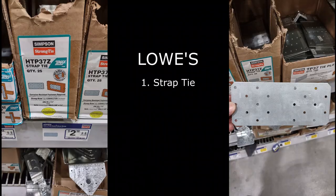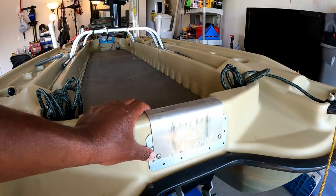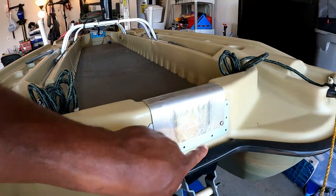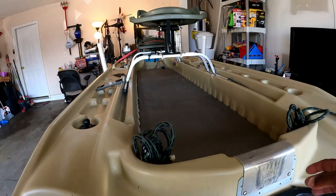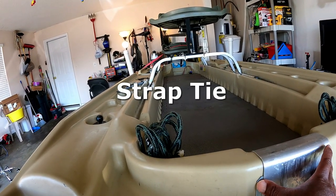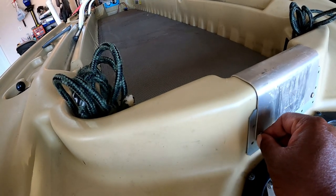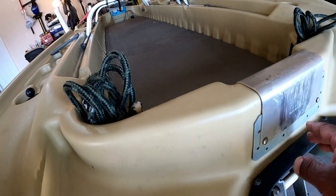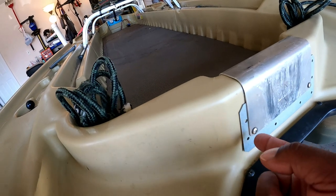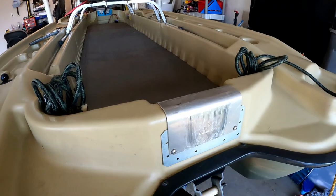So I had to do something about it. I went to my local Lowe's and purchased what they call a strap tie. A strap tie is a flat piece of metal used in construction of homes and small buildings to secure wood and prevent weak spots. I got lucky — the holes actually lined up perfectly with the holes on the boat's transom. I removed the four bolts that hold the transom together, slid that strap tie right underneath, put the transom back on top, and re-bolted both sides. If the holes don't line up, you can drill new ones with a metal bit.